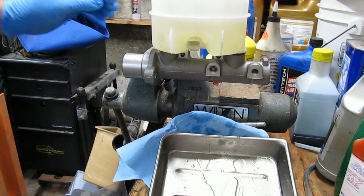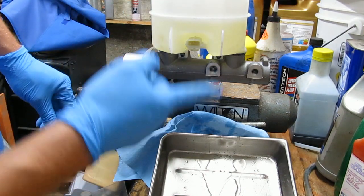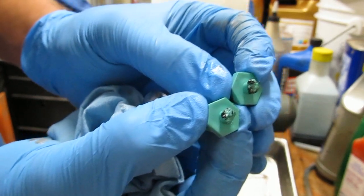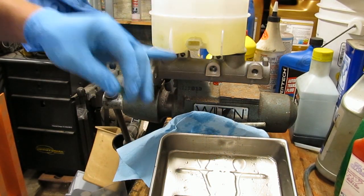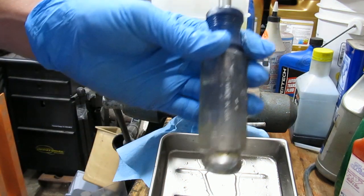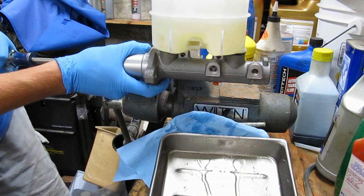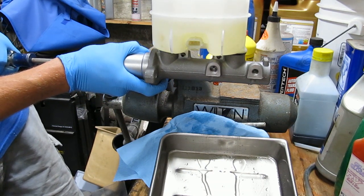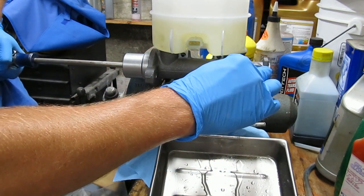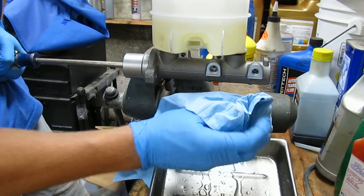Okay, I have the master cylinder in a vise now. I brought the fluid up to just above the minimum mark. Due to the hoses not reaching, I melted over the ends to make these plugs. Now, just having fluid in there, it's basically gravity bleeding. So I'm going to use a screwdriver. This is a large screwdriver, number 4 screwdriver. Just to show you, if I push in, but so it doesn't squirt out towards the camera, I'm just going to hold my fingers over it. Let me hold this over it.